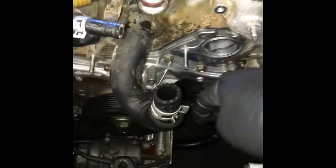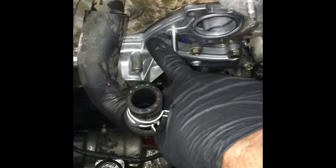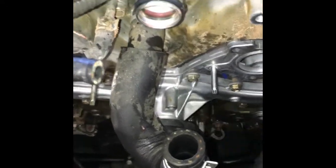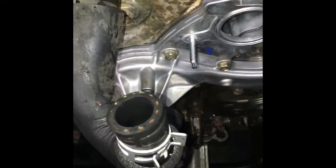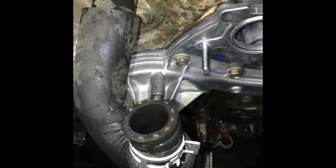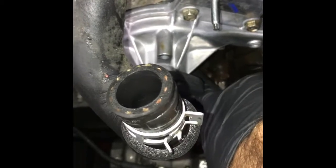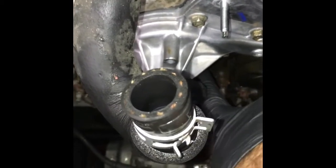You'll run them all up and torque them down. Running all the bolts up flush until the water pump is sitting flush — silicone on the 12 millimeters and Loctite thread sealer on the 10s — we're going to torque the 10 millimeter bolts first. Go from the inside and work your way out to the outer bolts. Torque those at 5 foot-pounds. If you don't have a torque wrench, tighten it up pretty snug. Then after the 10s are torqued, start from the bottom and torque the 12 millimeter bolts at 15 foot-pounds, starting from the middle and working your way around to the outer ones.